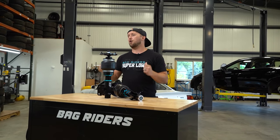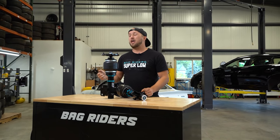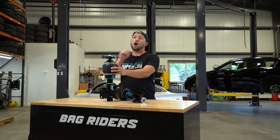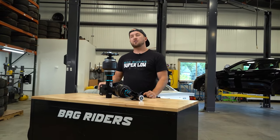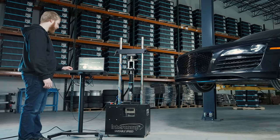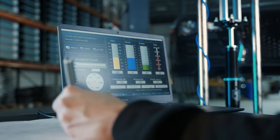If you've never experienced a failed spherical bearing, you can check out our own video on just what that is, what it looks like, what it sounds like — because it makes a really nasty clunk and you don't want that. The radial bearing is going to give you longer spherical bearing life and improve the steering feel in your vehicle. Tying all these parts together is a 20mm damper rod standard on all of our struts. A thicker rod is more resilient to side-to-side deflections and ensures damping force is yielded on even the smallest articulation.